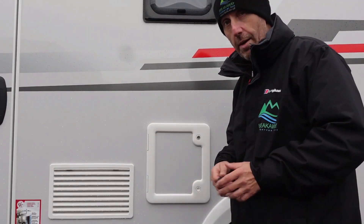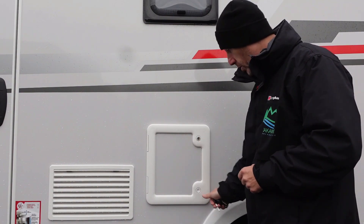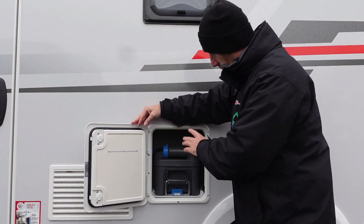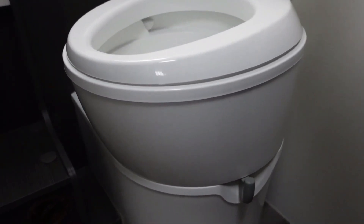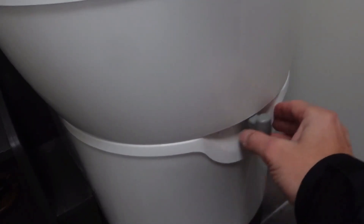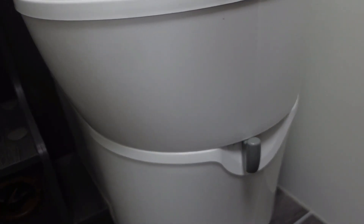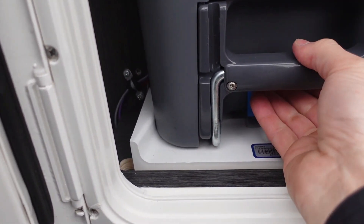When you need to empty your toilet cassette, use the same key as your habitation door. Put it in this top locker, turn it to the right half a turn, take it out. Push both buttons in together and the door will open. There is a little reminder on here — before you pull the cassette out, make sure you shut the blade on the toilet inside. This handle is the blade. The handle should be to the left to shut it, and to the right opens it. To remove the cassette, the blade must be in the shut position — then lift the little blue catch and the cassette will slide out.